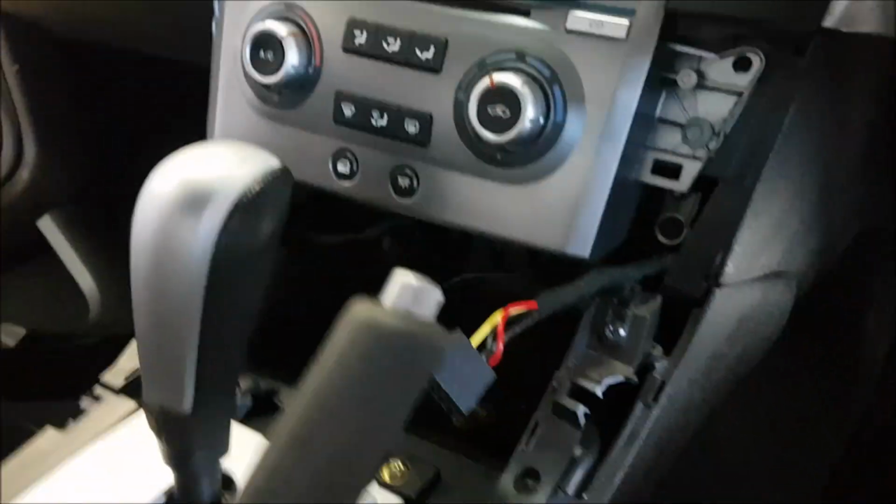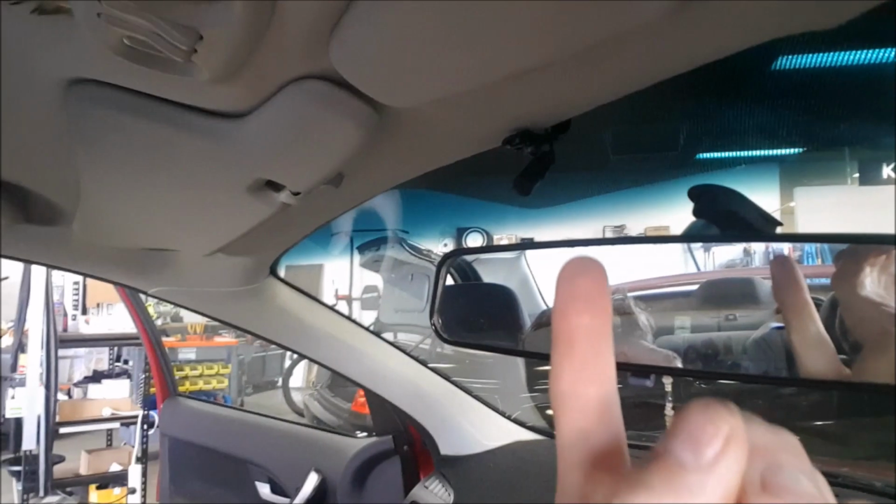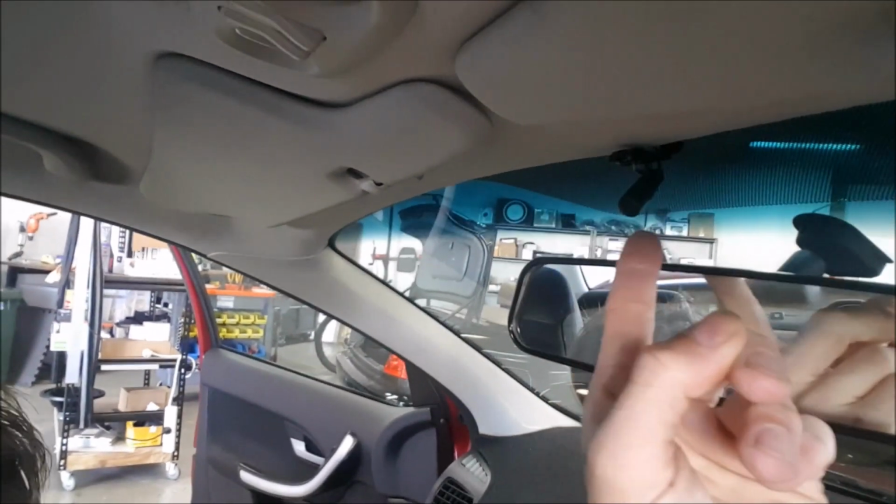So if you go down up under the factory fuse panel, you will find two plugs to attach the UF1 cable to. There's a blue one which has all the power connectors, and then a white 6-pin one which has the audio connectors. Clip those in and then carefully run the cable through back to the head unit section. You'll also need to install the microphone that comes with your new Bluetooth head unit. Put that in the center of the vehicle.